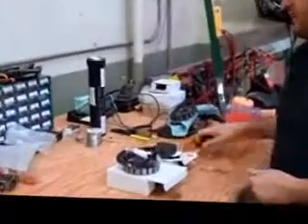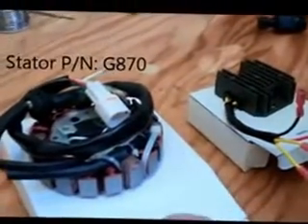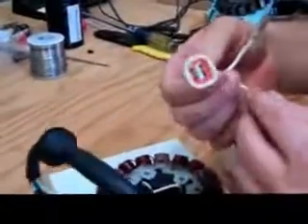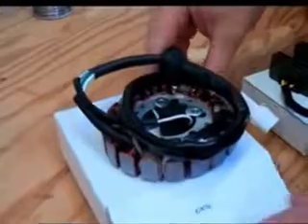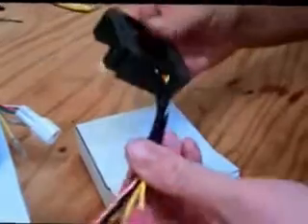You will need our stator that comes in the kit. It's our part number G870. This is our Banshee stator. It comes complete with pickup coil and original connector. These are your lighting charging outputs — ready to go, plug and play. You will have to reuse your backing plate from your original stator; we don't make them with the backing plate. You also have our R600 regulator. It's a rectifier as well, so this will let you charge your battery. It can easily handle up to about 300 watts, so 200 watts out of the Banshee stator sizes perfectly for this.